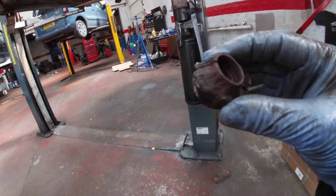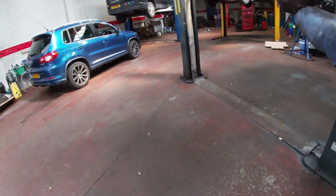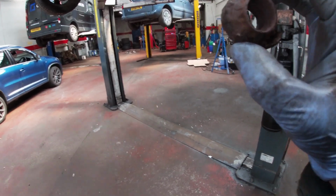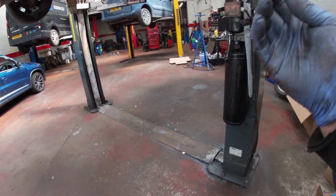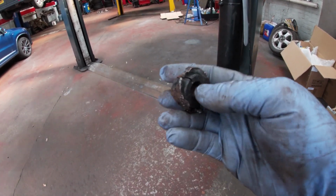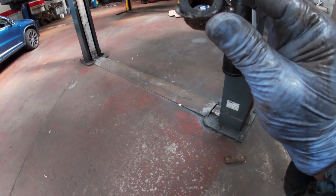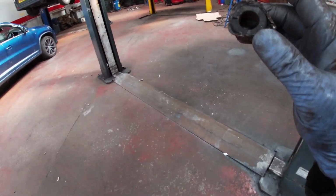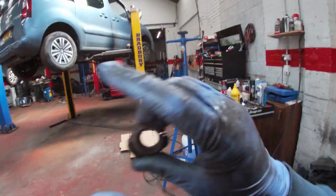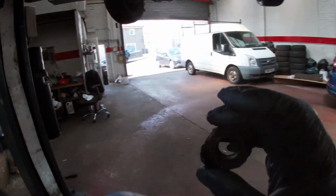The company that makes these cars, they would have originally made that exhaust, so they would have fabricated it. I think they wanted £260 plus the VAT just for the pipe on its own, so it was absolutely crazy. And then we've got the labour, and then it needs welded in anyway, so we would have still had to modify it. Normally what would happen in an exhaust is you would just get a boss, bore a hole, put the boss in it, weld the boss. What they did was got another exhaust, chopped a big huge square out of it with the boss in it, and then welded that onto the pipe that they had made. So that's how they did it, not how we did it.